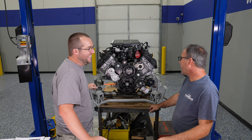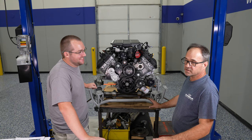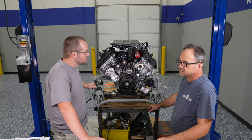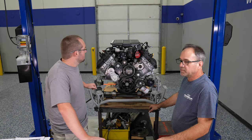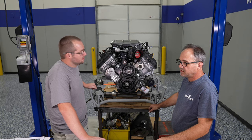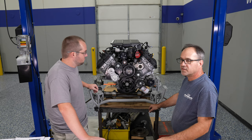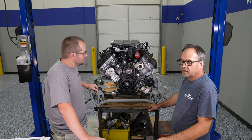We're not quite ready to start it up yet. At this point, with the exception of the transmission not being attached, it's ready to go back in the car. The wiring harness has not been installed yet. There are a couple of notes in the installation manual about the wiring harness — the intake manifold runner controllers will be unplugged and need to be taped off so the wires don't get damaged, in case you ever pull it off and want to reattach the connectors to the original manifold. Everything we did is reversible — we haven't changed anything that can't be undone. If you decided you were getting rid of the car and wanted to take it off, everything can be reinstalled as it came apart.